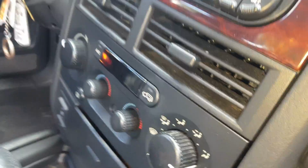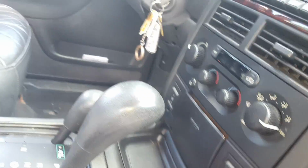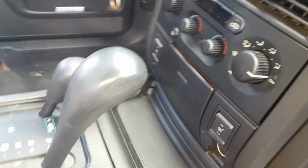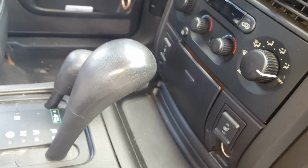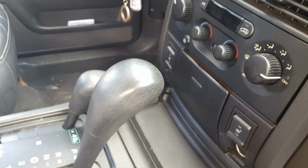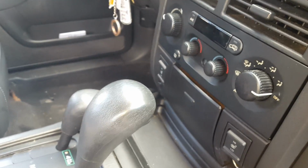So I was having an issue in my last video with the air not blowing out of the vents. So I found out what the issue was. After looking around online, some people were saying it might be the blend doors, which was not the issue. It was actually the recirculation door. Basically, the recirculation allows you to either allow the air from outside in or recirculate the AC around